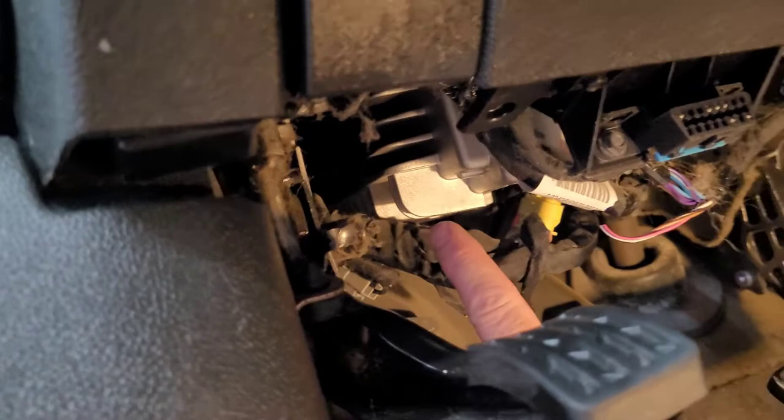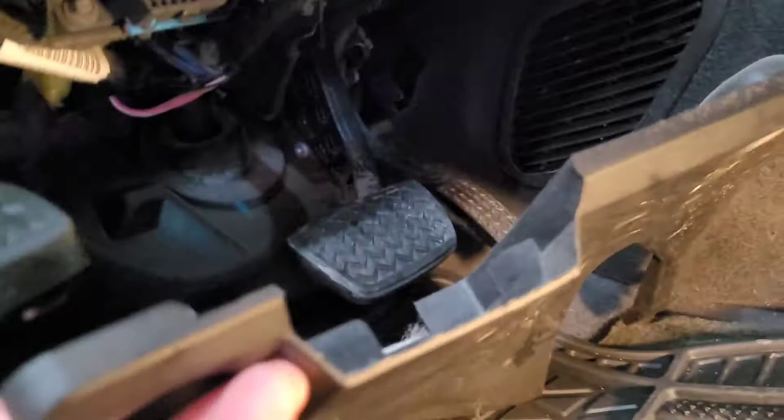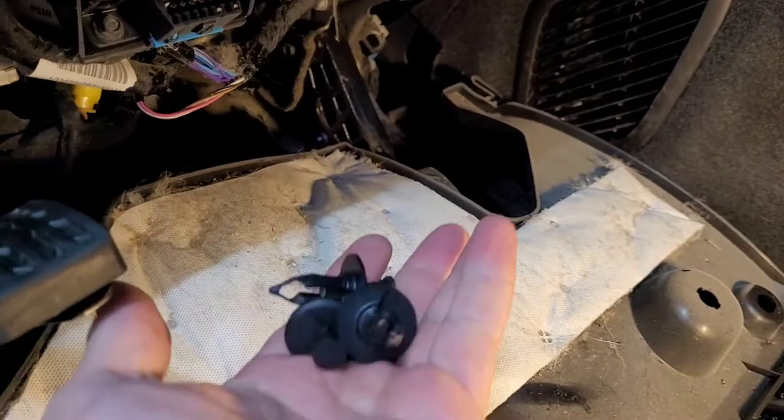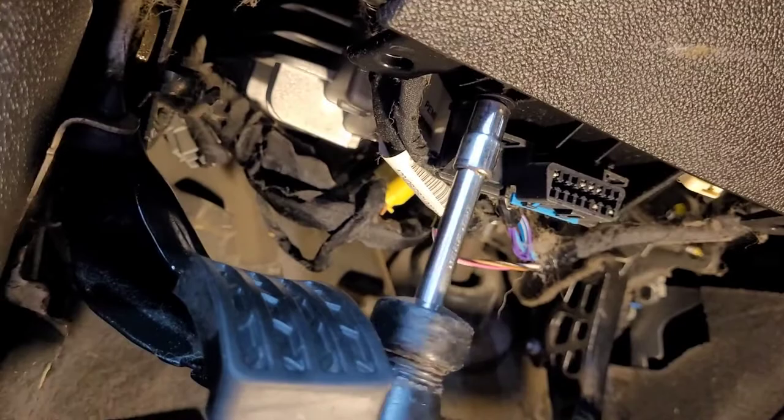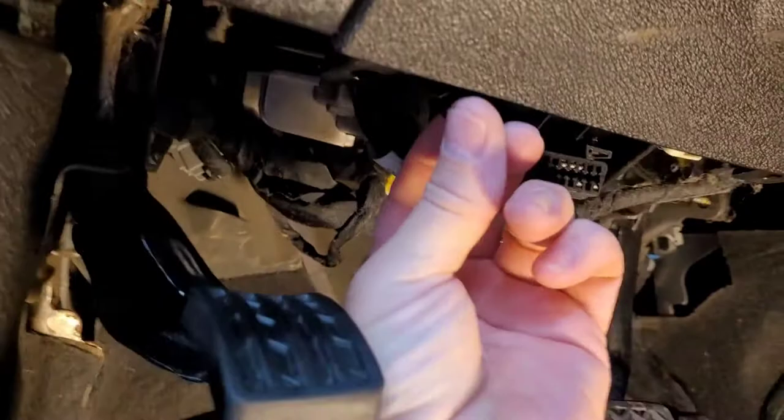The amp is up here above the emergency brake. It looks like it's pretty tough to get to. I took this plastic cover off — it was held in with three push pins, so we've got that out of the way. Then it looks like we've got a couple of 7mm screws in the bottom of this panel, and it probably just pops off. I'm going to take the screws out of the bottom — I think it might give me some more light in there and help me see it better.